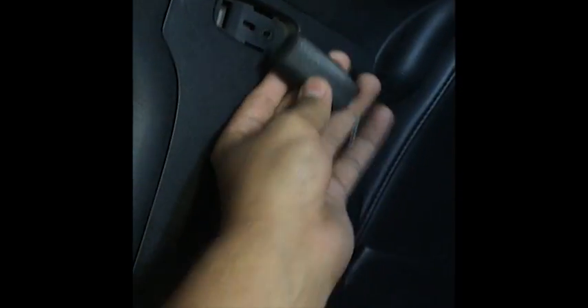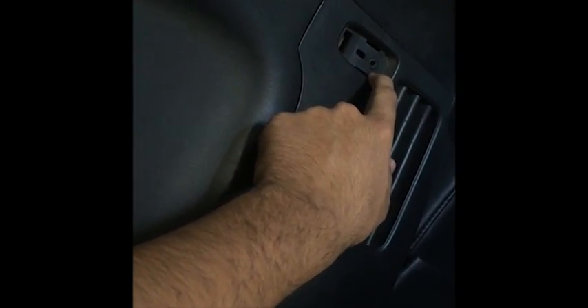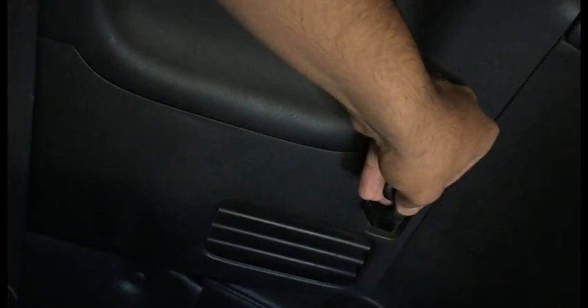When you're going to install the hardtop, your car may still have the little hanger clips back here. It's basically like one of these with a clip underneath — apparently meant to hold clothes like a hanger. Make sure you unscrew that with a Phillips head screwdriver; it'll just come off as two pieces. Just unhook it — you won't need it and everything pops back into place.